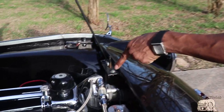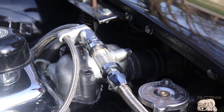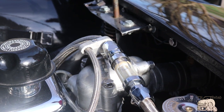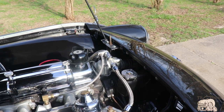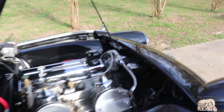At this point, my fuel filter is telling me something different. I'm actually getting some fuel to the system, so I would imagine that it'll crank now. Let's see how that goes. I'm going to start it from the solenoid, just to make it real simple.